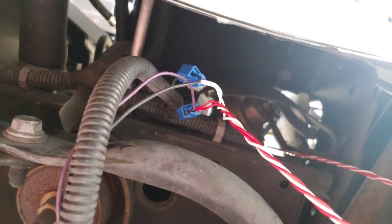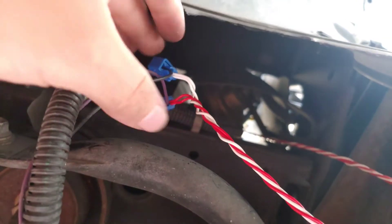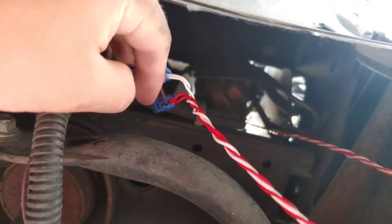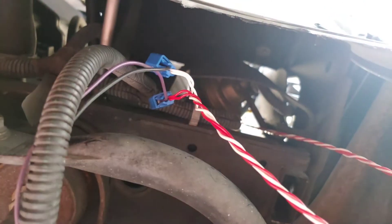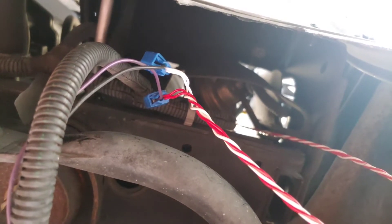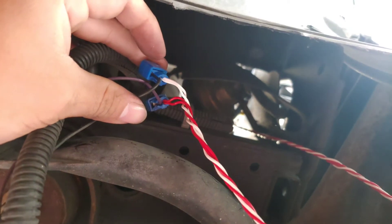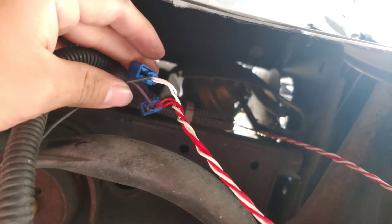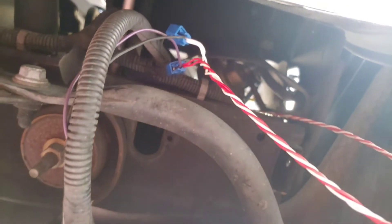This is how it looks under where the fog lights are. The purple wire is your positive, so I'm using my red for positive. I've spliced the T-tap onto the purple one and twisted the two red wires together. You do the same for the negative - I've tapped into the black wire which is my negative and twisted up my two wires as well. There we have it.